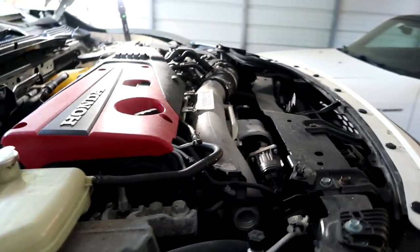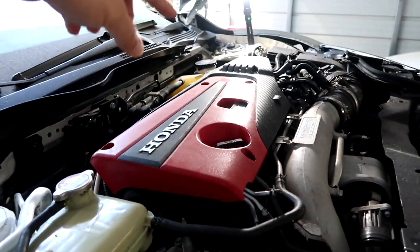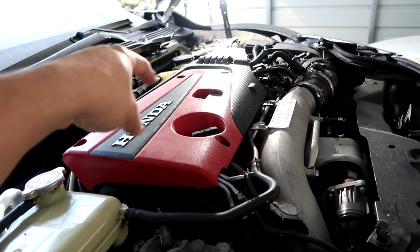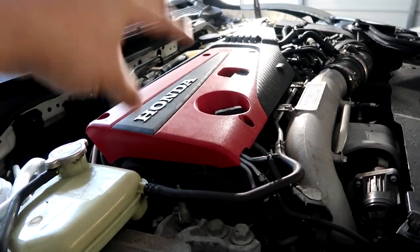Now, in case you guys haven't seen, there's also some corrosion issues. If you open this up, there's four spark plugs in there. There's some moisture that can get into the spark plug tubes and they can rust some things out inside the engine. I made a video on that. I'll go ahead and post it down in the description.